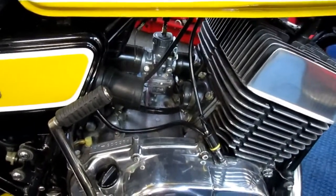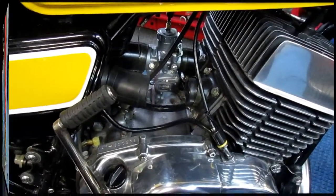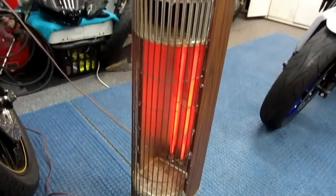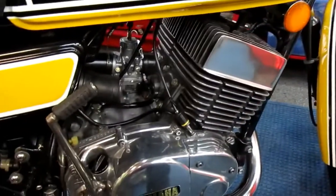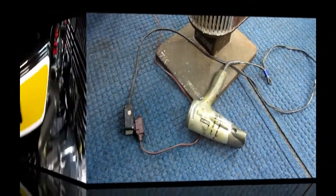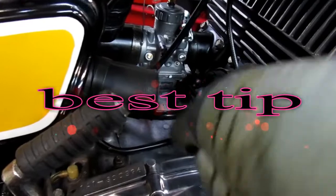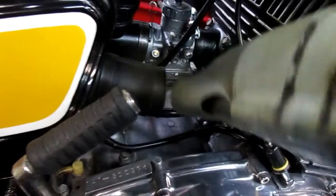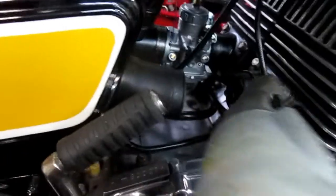Of course, if you're doing this on a sunny, bright day, that's not a factor. And on really cold days, having that quartz heater really pays for itself, because it just makes everything a little warmer than room temperature. And then having a hair dryer just before you put the parts in is worth its weight in gold. That's the best tip in all of motorcycling. Whenever you're dealing with old rubber that's hardened, get it warm. And if you're using a heat gun, be careful, you can catch it on fire. That's for sure.